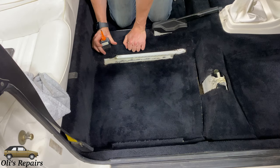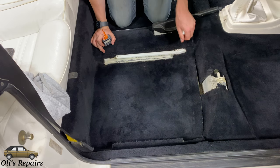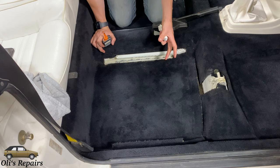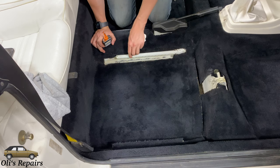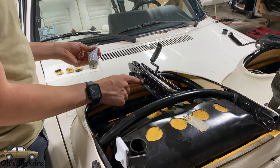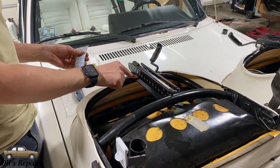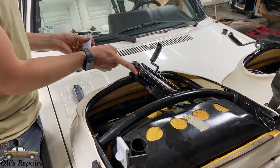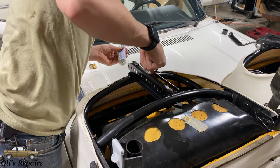This graphite lubricant is obviously a dark gray, so since I have black carpet it works out — if a little bit makes it onto the carpet when the seats are being slid in and out, that's no problem. If you don't have dark carpet, you can use either a wax-based lubricant or you can even just not lubricate it. Again, it's plastic sliding on metal rails — the plastic will give way before the metal rails, and the plastic is easy to replace. Greasing the seat rail with a little bit of silicone-based lubricant: I'm focusing my greasing efforts on this metal portion, because that's what we'll be sliding on top of that rubber piece that we also greased. A little bit can be applied to the sides here as well, but you do not need very much grease at all.